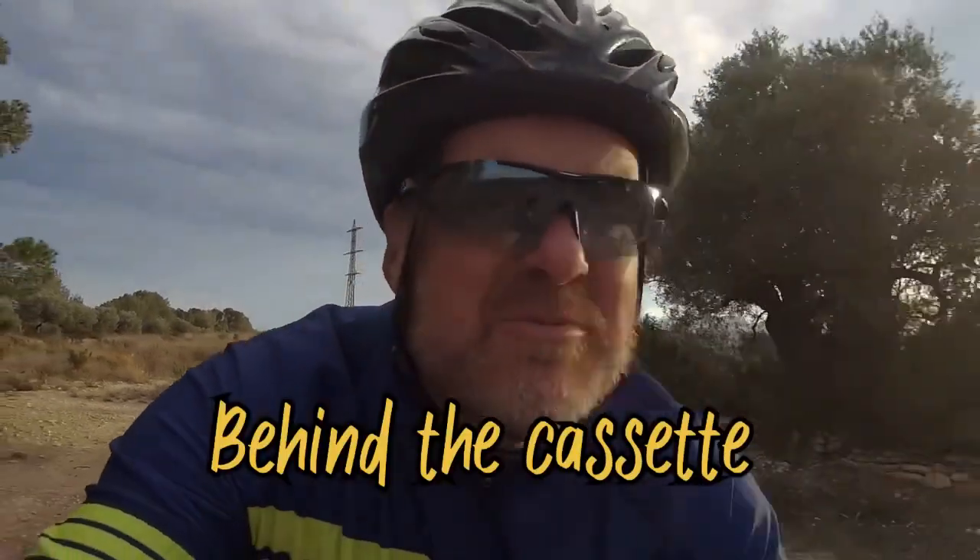Well, that was a fantastically successful trip. Dave wasn't so keen on being filmed — fair enough. But we did the bleeding of the brakes, and we found the clonk. And it was the axle — a nut on the axle. Very weird. Would never have found it unless I happened to have the wheel off and was looking at something else. We were only just trying to put the nut back on to put the wheel back on and thought, that's a bit funny. We had a look and it was all out of alignment. So I'm going to tell you exactly what it was later in case you're an Orbea Gain rider. But this is something that could happen to any of us. It's a dead easy fix. So there's no clonk, and I'm very happy.